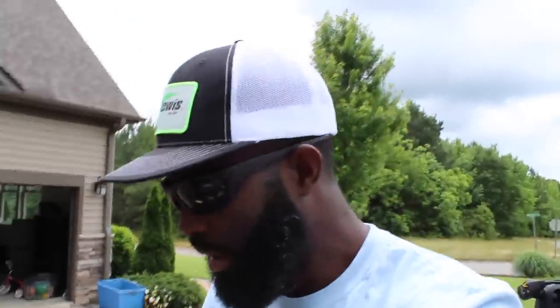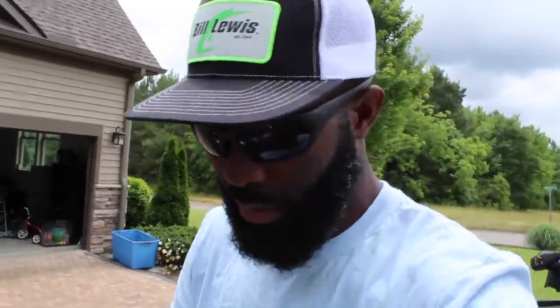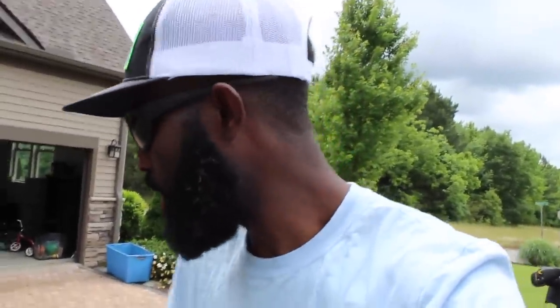So if your live well doesn't have the drainage system like what I have here, the very first thing you need to do is take your shop vac, take some paper towels, take a towel, whatever, and vacuum out all the loose material. You can fill up your live wells a little bit and take a net in there and get up some of that loose rock and sediment, the crawfish pinchers, and shad, whatever's in the bottom of your live well. You can get that out with the shop vac. So we'll start with that first.